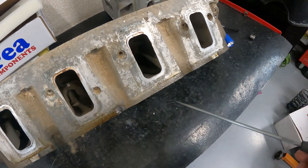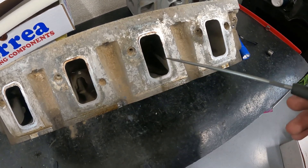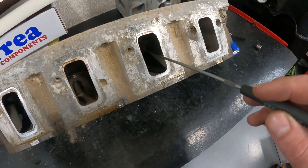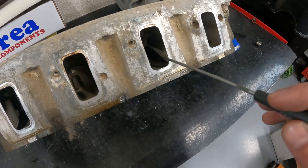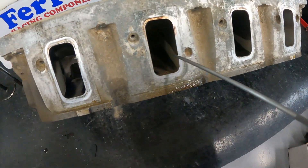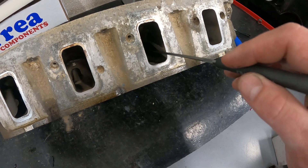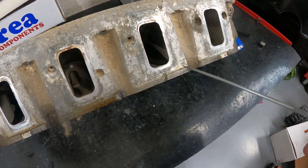That's part of it. The other thing: if you've got old school Chevys or other old school engines, you'll see this huge caking of carbon. The reason why that happens is because the rings don't seal up as well on some of the older engines. Besides reversion having some unburnt fuel coming up, you also have oil coming up. And oil takes a much higher temperature to burn, so it mixes with that stuff and sticks harder to the wall and doesn't come off as easily. LS engines, for the most part, do seal up better as far as the rings go, so you usually have less of that — but you still have it clearly. Also, if you have crappier injectors that spray more raw fuel with a bad pattern, you'll have worse deposits — raw fuel droplets with reversion coming up, heating them up just enough to halfway burn, and they just stay stuck there.